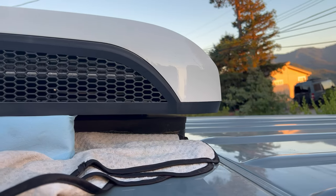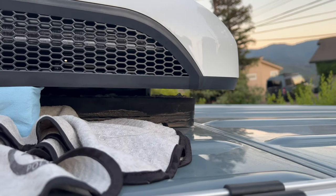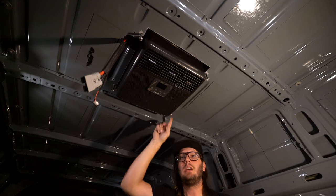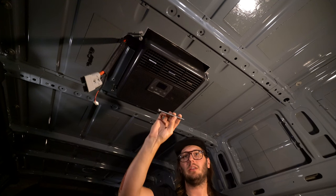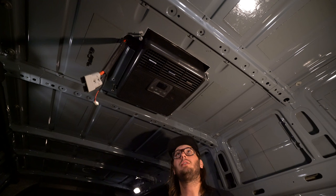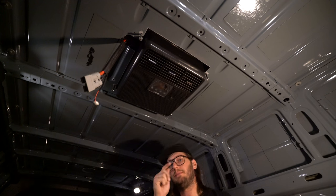I'm using this clear RTV and I'll basically go and apply that around all the way around and then bolt it down to the required specifications. We got that all spread out around the whole perimeter and we're going to go ahead and drop this AC down. We're inside the van here. We're going to pull out our original bolts — these were the shorter ones — and install our new bolts. I ended up with 110 fully threaded. I'll put the link in the description below. These are perfect for a 144 with my countersunk brackets, the adapter and the 1 inch spacer and the mini cell foam on top. We're going to put the brackets up, tighten everything down, let the adhesive dry, and then do a final tighten to spec to lock everything into place.